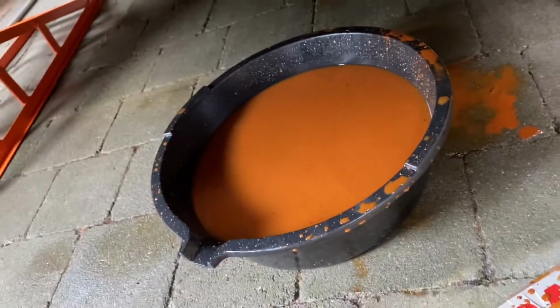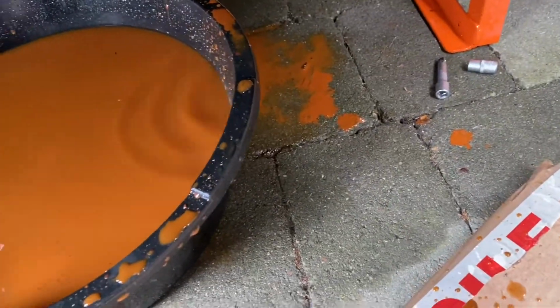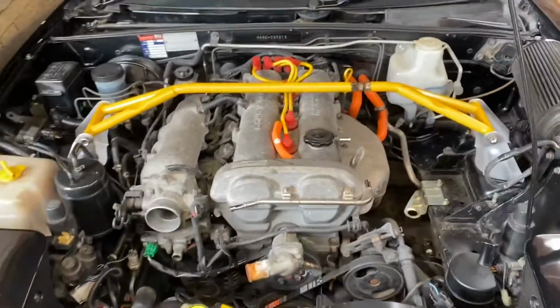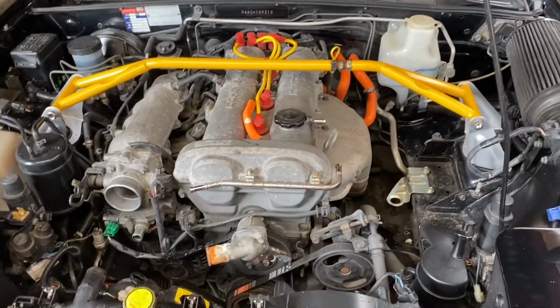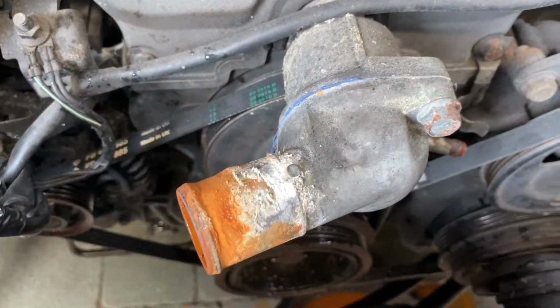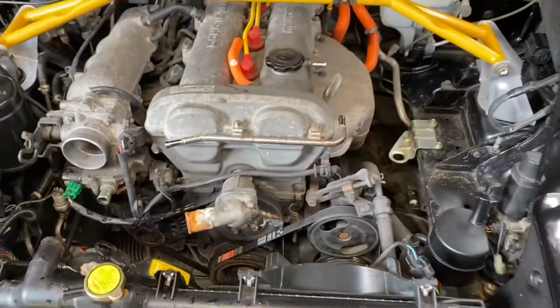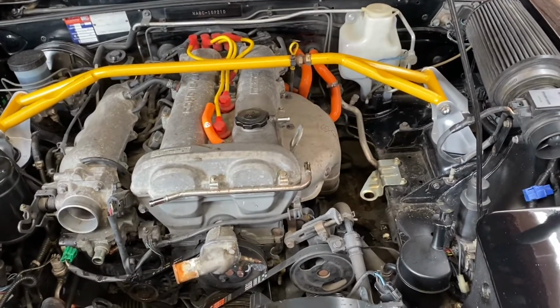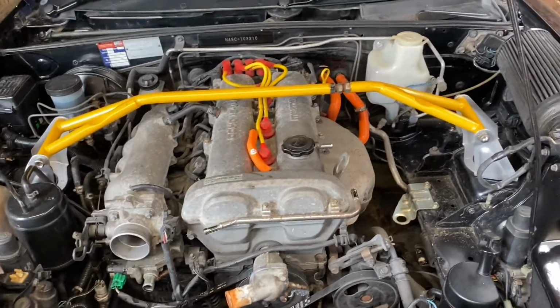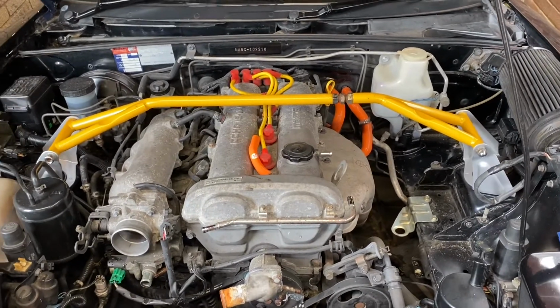And that's all the coolant coming out. So pretty much looks, I don't know if it's rusty or that's just the color of the coolant the previous owner used, but yeah, so engine's all pretty much stripped down, and those back two. I'm going to tackle those now and get them off, and then I got to take the thermostat out and clean up that. Got a new thermostat upstairs, so I'm going to take the thermostat out and reinstall that housing without the thermostat because I got to flush the system to get rid of all this old coolant, and because I'm putting fresh new coolant in.